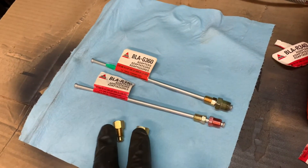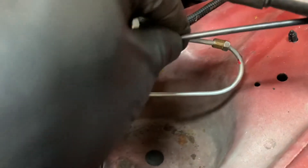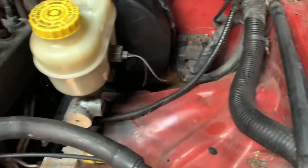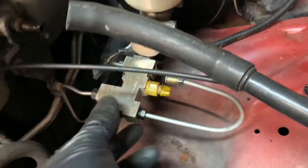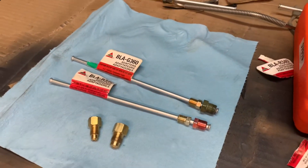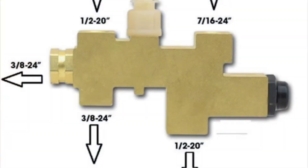These screw into the master cylinder, these screw into the adapters — just do a couple of little test fittings and be on your merry way. As you can see, everything is still being mocked up. You'll cinch those bolts, mock up and bend the lines, run the rest of the lines, do your brake bleeding, and that's it. Here's a picture of the brake proportioning valve with the different adapters and the various thread pitches.